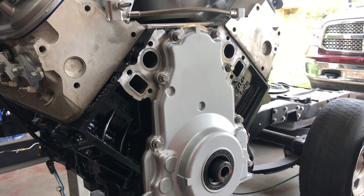All that will be left is to run your harmonic balancer back on. I'm going to be running ARP crank bolts as well. It's not torque with degrees — it's just straight 240 foot pounds. And that's all it takes to install the front cover.